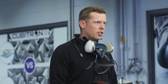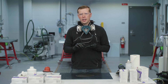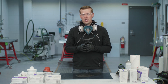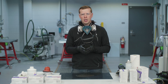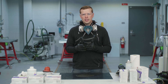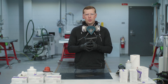The recommendation is just a medium amount of dry guide coat applied to the body filler. The powder is actually going to weep down deep into coarse-grade inline sand scratches, versus an aerosol or liquid guide coat can actually just bridge over the top of the sand scratches. Both products will work well for high spots or low spots, but really what we're focused on today is having the ability to refine coarse-grade or inline sand scratches with a DA, and it's next to impossible to do that without the use of dry guide coat.